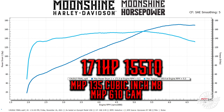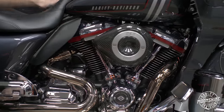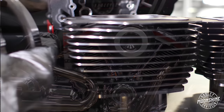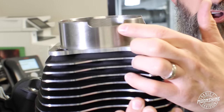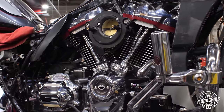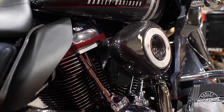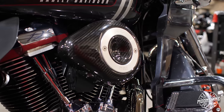If that's your setup, we are running a factory cylinder that has actually been bored. We take out the factory sleeve from the cylinder and put in our larger ductile iron, which is 113 thou thick all the way down to the bottom of the spigot. The spigot goes in the case on these guys. Since it's so thick and big on the spigot, we have to bore the case. Our 131s, we do not bore the case — when we step up to the 135, it is the first engine we do a case bore.